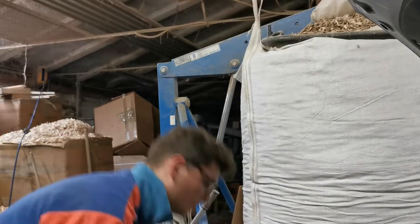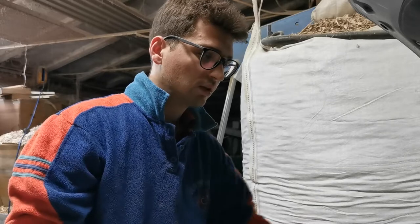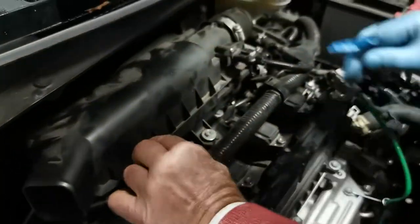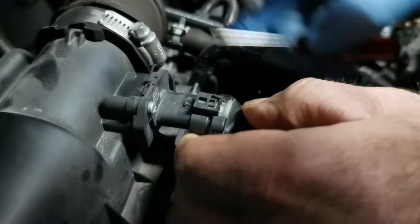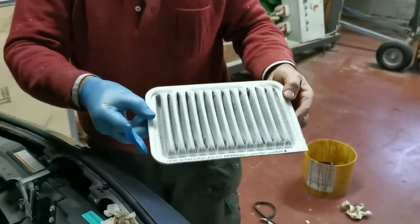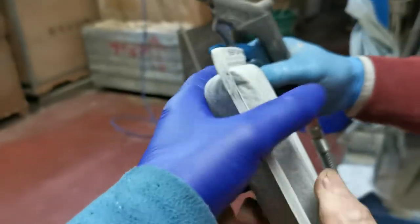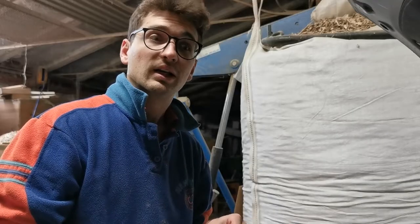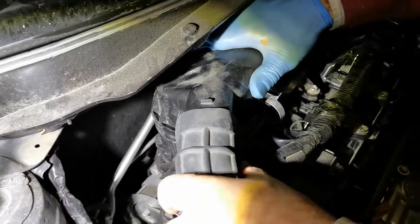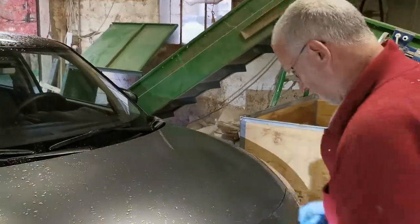In the second part of the video I'm going to show you how to check the air filter. You can access it really easily because it is on top of the engine — you have to remove the first intake collector, remove the electrical connector, and then you can open everything. In this case, my filter is really clean so I'm not going to change it — this is only a check. Once done, you remount everything and you're good.